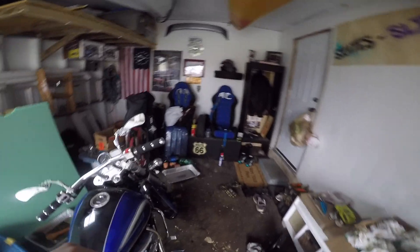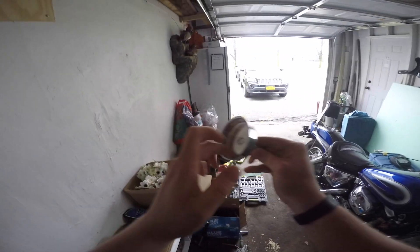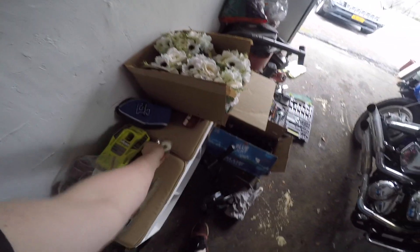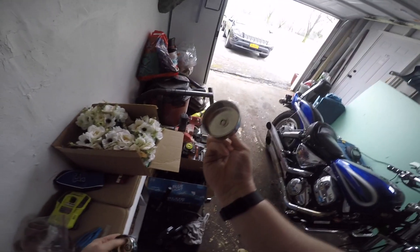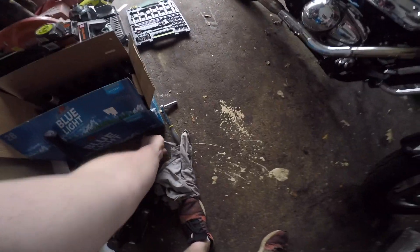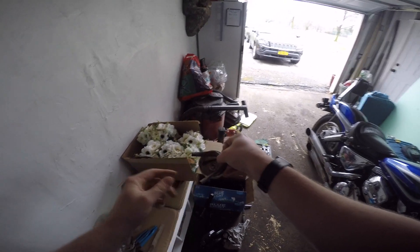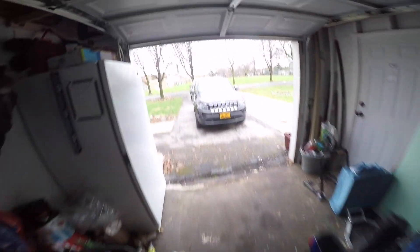I just changed the oil on the bike. The oil filter that was on it was a little too small for this one. I bought this one last year for my other bike, had to buy a different one this year for this bike — just a little bit bigger oil filter. What I had to do is take a piece of gorilla tape, wrap it around the oil filter so it went inside, and then started turning it to help it out. Now we're going to start the bike up and get that oil moving through.